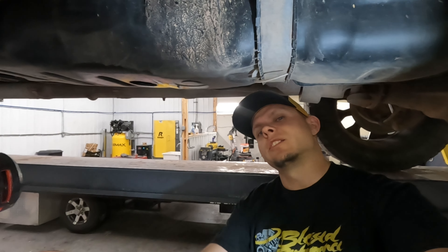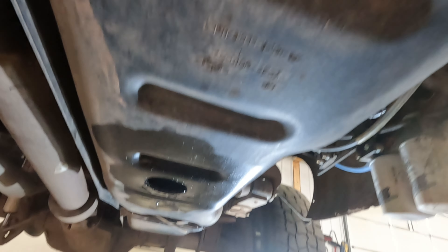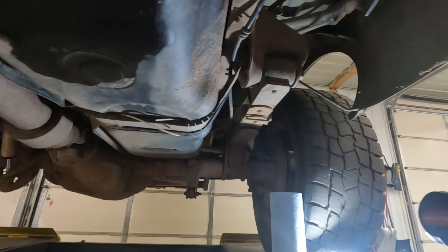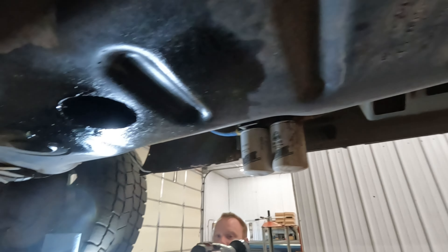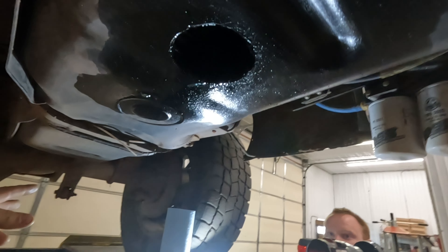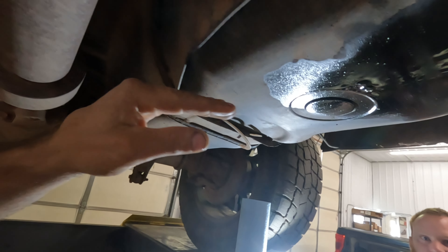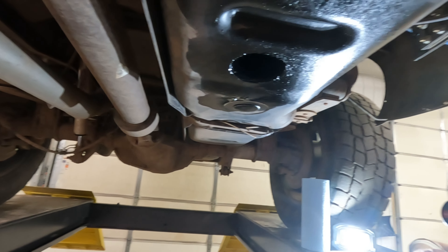This is on a 6.0 Power Stroke. Every truck has a little bit of different design to it. I don't put it in the very back because it gets too close to the drive shaft and doesn't give a good way to protect it. If I'm on a 6% grade and I'm down to like a gallon, there's a pretty good chance I'm not going to get fuel back there. So I wouldn't say run it down to less than a gallon — I don't say that for any diesel, it doesn't matter the situation.